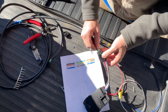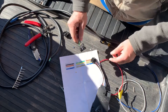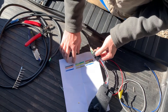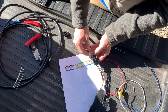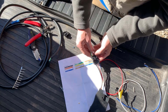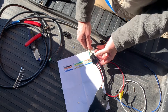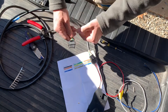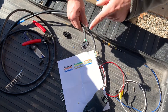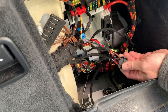Fast forward: we've connected the female end onto the harness per our diagram. Green, which is our positive, goes to black. Yellow, which is our brake/stoplight, goes to red. White goes to white, which is our ground. Trailer brakes, which is blue, goes to brown on the harness. I already completed the other end before making this video, so all that's left is to go to the car end — we have to cut off the connector and take it from there.